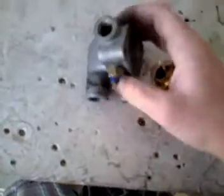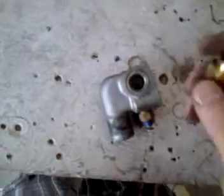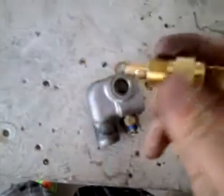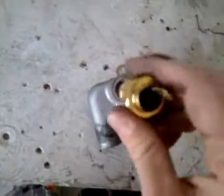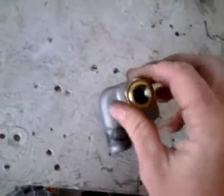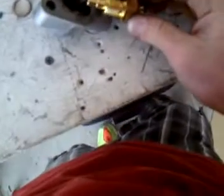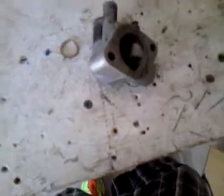What I'm going to be doing is drilling this out a little bit smaller than the 3/8" size, and then using a 3/8" tap to tap the threads in here. This will basically get right in here, and it'll basically look stock when it's in, which is what I'm going for — a stock look.